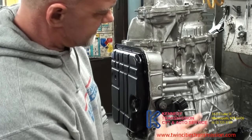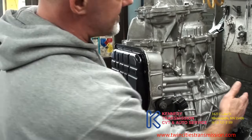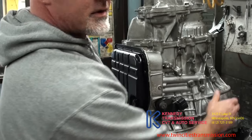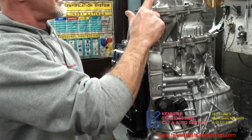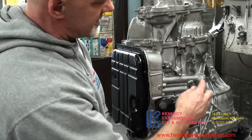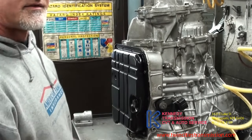You can tell the difference between the two. On the TR690, the valve body is on the bottom. On the TR580, the valve body is on the top. Also, the TR690 has four sections: extension housing, intermediate, the case, and the bell housing. The TR580 has three sections.